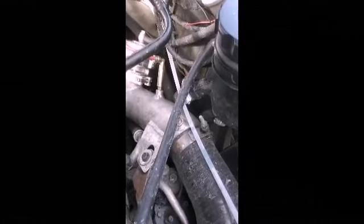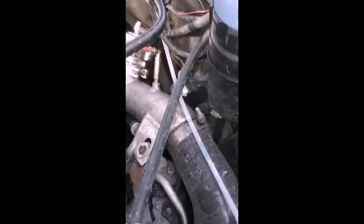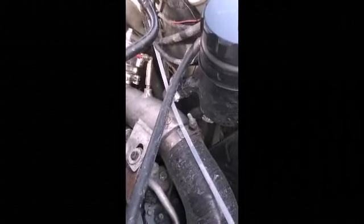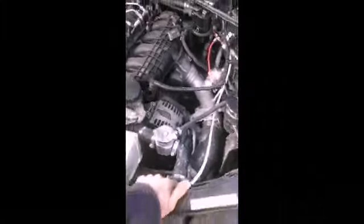Dropped you. So we changed out the spring in the blow-off valve because that was too tight. That was another thing we were dealing with. It needs to be open at idle. It has to. It's an 11 PSI spring, or else you're going to cause a shit ton of compressor surge if it's not opening and closing at the right time. Don't mind all this mess. This was me checking pressure and level, and it was holding pressure, and I forgot there was still pressure, so she squirted a little. But this is the intake I made.